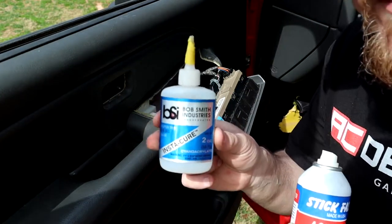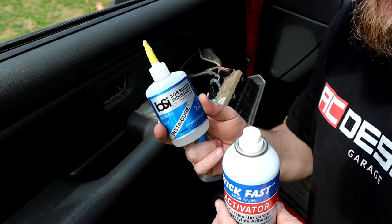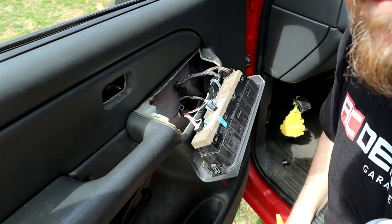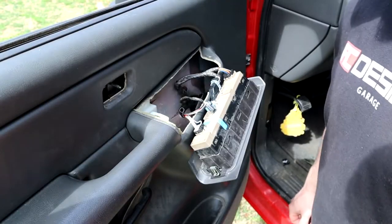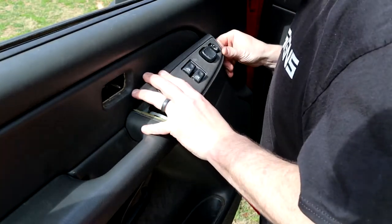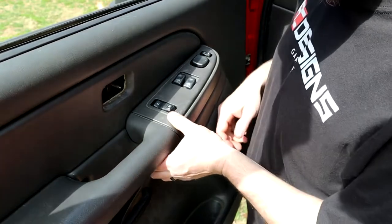We're going to try to fix that little tab. Here's some CA glue — I'll link this in the description. It's basically hot rod super glue, and this is an accelerator: when you spray this on it instantly locks. But be very careful — this stuff can stick your fingers together and you'd have to go to the hospital to get them cut apart. All I'm going to do is dribble a little of the thin stuff on, spray the accelerator on, and it's dry. Dribble that on, spray that on, and it's dry — cool little tip. Try this stuff, but again be very careful. Now I'm going to attempt to put this thing together — it's probably going to break, but hey it's worth a shot. And I think it might have held!